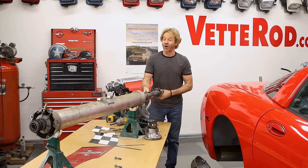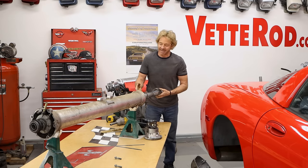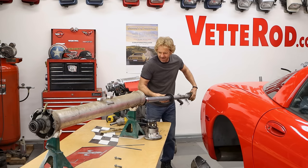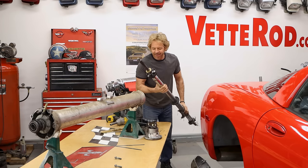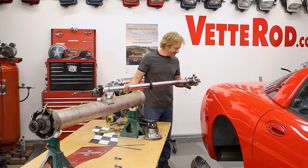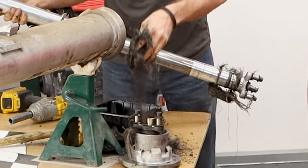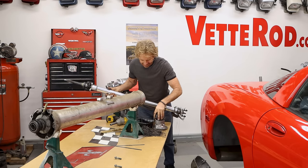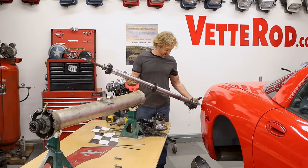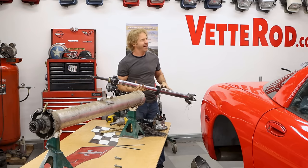This is good though. I've never been so happy to see something so destroyed. This was making some noise. This coupler is better than the other coupler, but wow — that is destroyed. That's supposed to be a rubber coupler. Look, there's aluminum in here. That is a destroyed torque tube. This was definitely making noise. I didn't want to be wrong here.